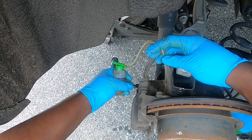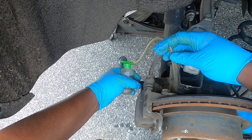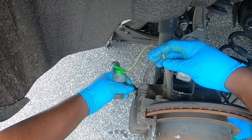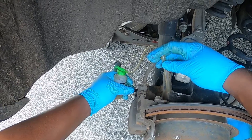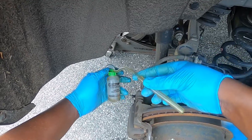What I like to do here is crack open the bleeder valve — it's a good idea so rust doesn't build up. Another thing I'm going to do is get rid of the old fluid so the car can introduce new fluid. Better quality brake fluid means better brake feel and better performance. I've got a one-man bleeder right here with a hose.